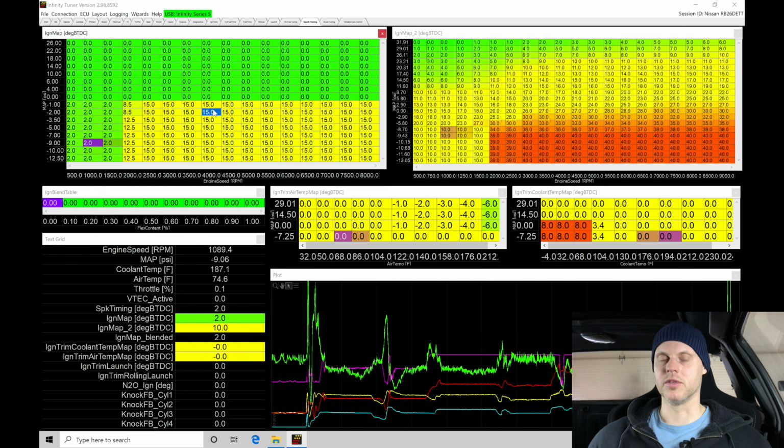What we're gonna do here is relatively simple. I'm going to bring the engine up into certain RPM ranges. In this case, I can't go much lower than probably -5, -7. I will pre-highlight this area here and we'll drive it at 2000, and I will increase my timing as I start to hold it at a fixed throttle angle.